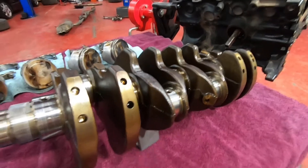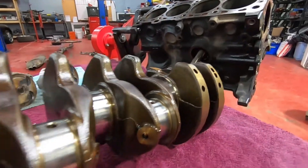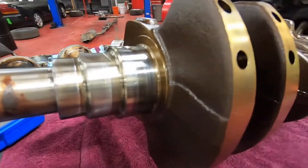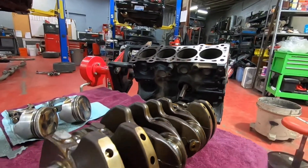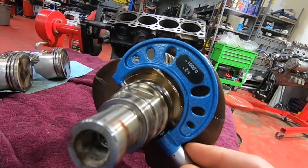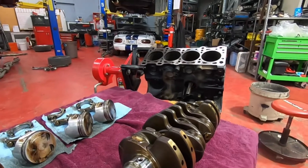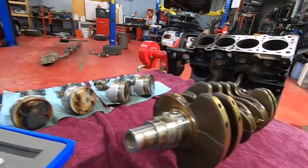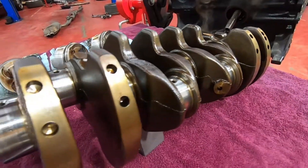When doing the measurements on the engine, what you're going to figure out is that for both the engine block itself and for the crankshaft, everything that we're going to be measuring on there are cylinders. When measuring something that has a cylinder shape to it, there are a couple of key measurements that will tell us everything we need to know. The first and most obvious one is going to be the diameter. We can take the micrometer and measure the diameter at any given point, and we'll do that for all of them. For the cylinders, we'll use the T-gauge, size that into the actual cylinder up against the walls, and then measure it with a micrometer — giving us our first indication of the actual diameter of the cylinders as well as the bearing journals.